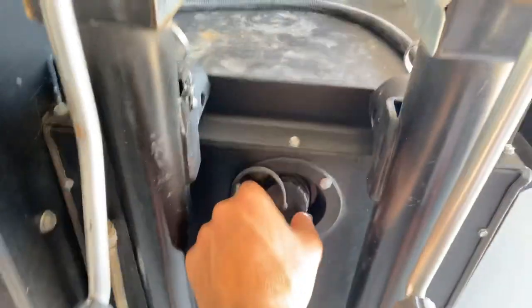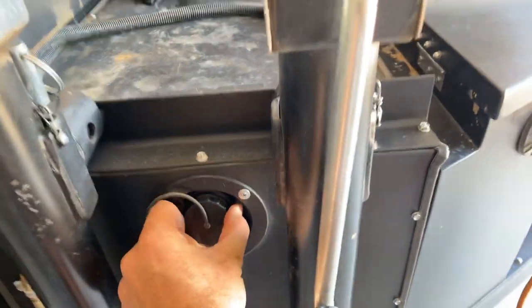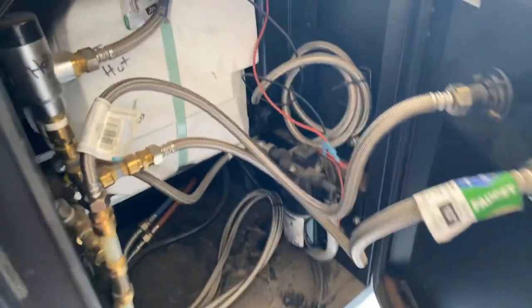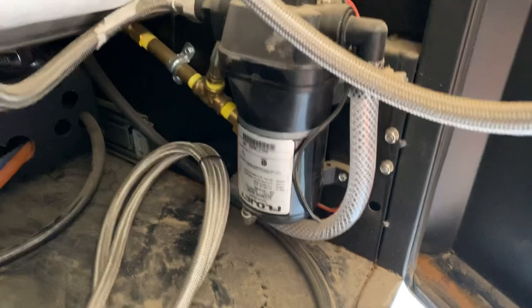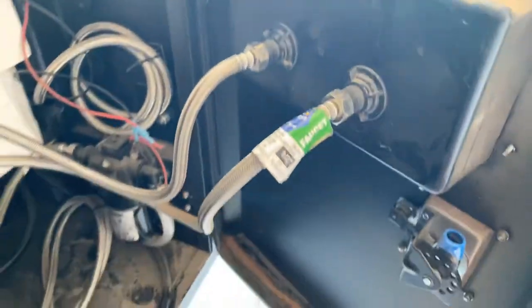We're about half-full right now. We bought an RV fill spout, so that's where you'd fill up. Like I mentioned, we have a water heater — that's the front of it, where it vents. There's an outdoor shower, which gets used all the time. And then in here is where we distribute water, propane, et cetera. This is your hot and cold lines, that's the 12-volt water pump that feeds from the actual water tanks, and then lines feeding the shower.